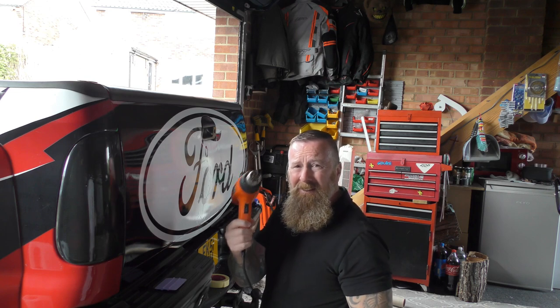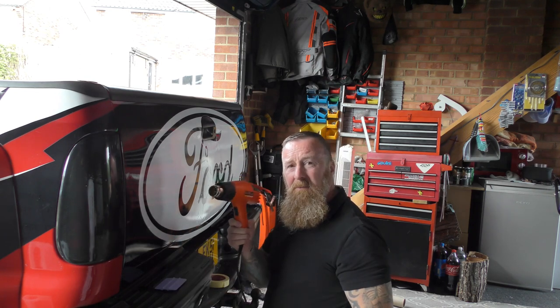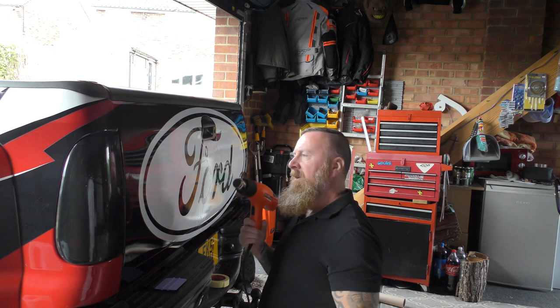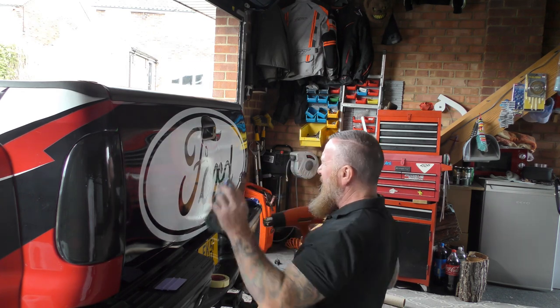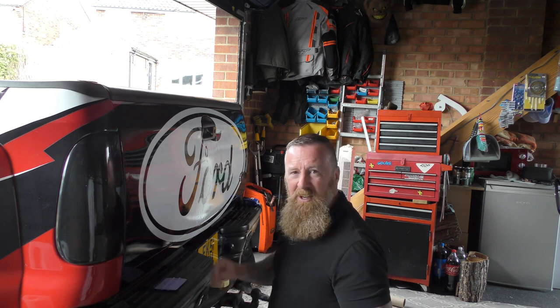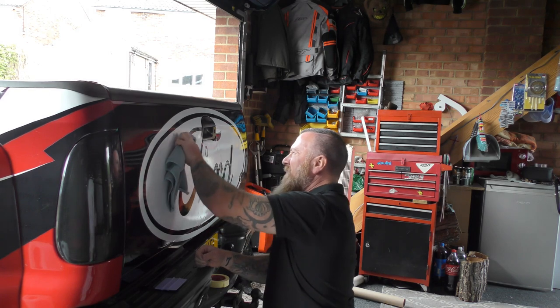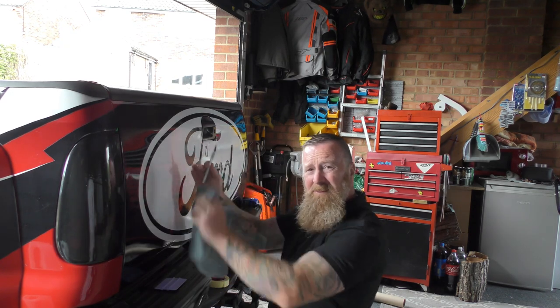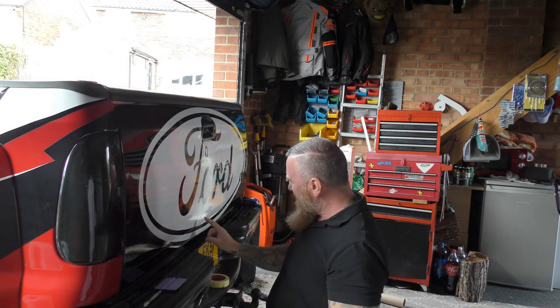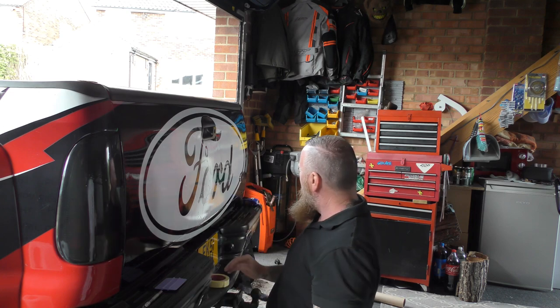This heat gun helps so much on the bends — you can blow it over and it very nicely flattens things down. Don't leave it on too long or you'll stretch and ruin it. There are bumps, not bubbles — it's all bumps underneath it. Sometimes when water gets under a large area and you can't keep taking it up and down, you use a small scalpel, slice it, and then push the water out. You don't see the little cut, but I've had to trim here and here.